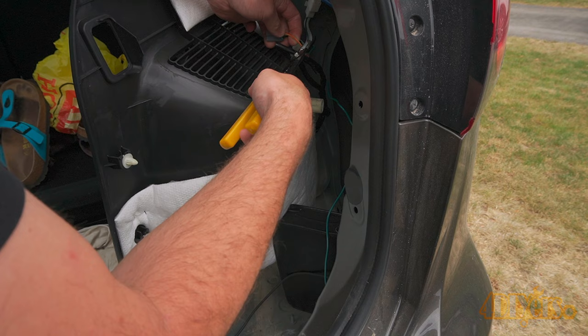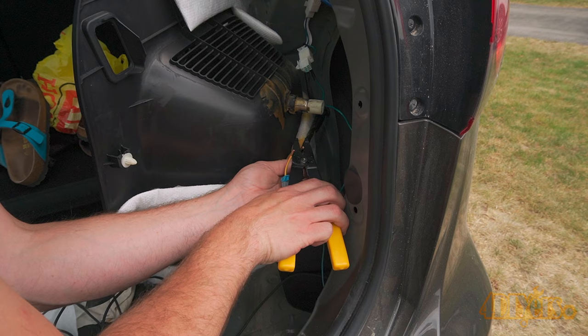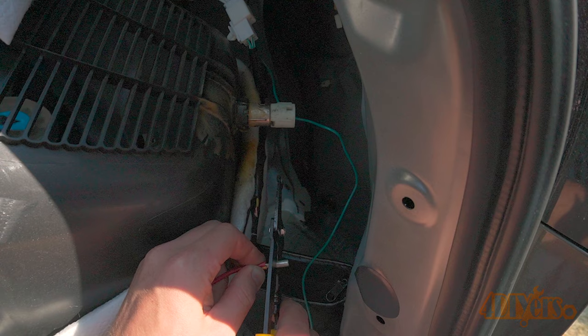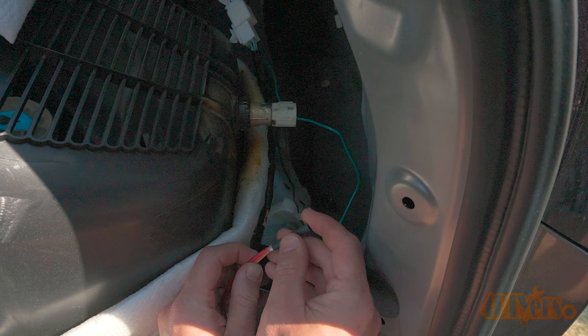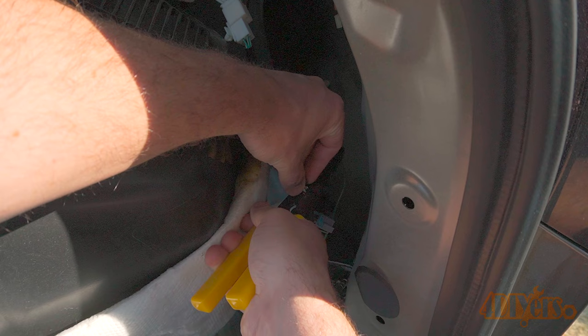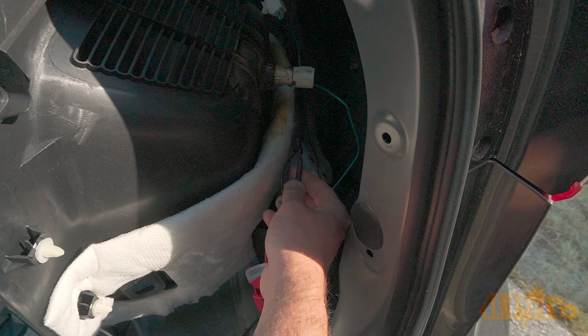The trunk area has a constant 12V power source which feeds the 12V power outlet. I'll tap into this source instead of running the wire directly to the battery. The fuse has been removed for the circuit and then the wire to the back of the plug is cut and stripped. The red and yellow wire is used for power. The wire strands are twisted together and one side will have the inline fuse connected. I then used a bare butt connector to crimp onto the connection. Heat shrink is applied to this connection — this will strengthen up the connection and provide a good seal. After that, the opposite side is inserted and crimped, and a heat gun is used on the shrink tube.